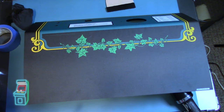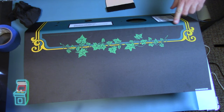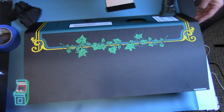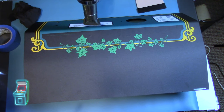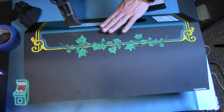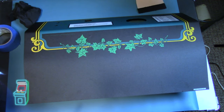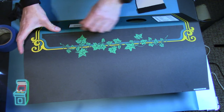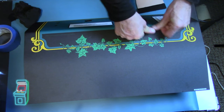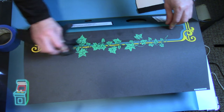That looks good — now I'm going to use the squeegee. You can hear some air bubbles in there — just trying to get those out. This to me is the most critical part of the whole panel before I get the other stuff stuck on there. I think I'm going to heat it up one more time — now that I have both hands available — and push it down, because this part was the part that cracks on mine. It's nice and hot — I'm just feeling it. See how I'm moving it around — never leaving it straight on one point, always moving the air around. Just heating it up a little bit. Don't put the heat gun down on there because it will melt the panel — that would be horrible.